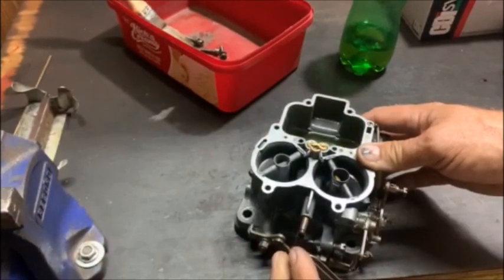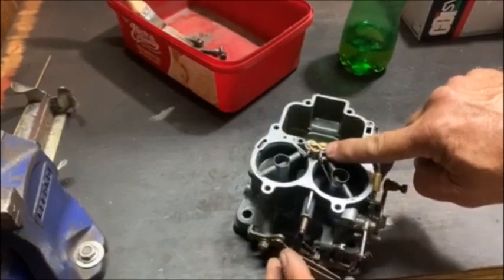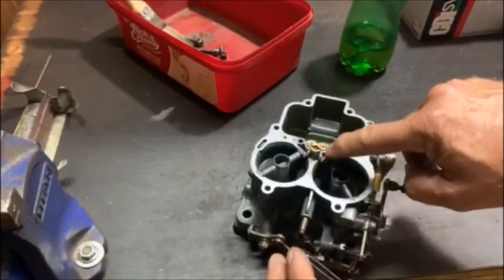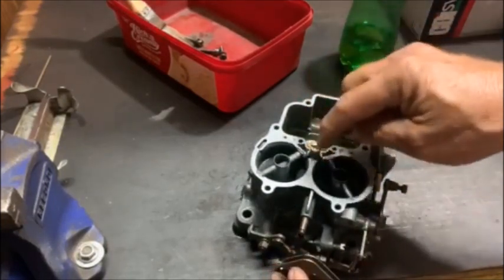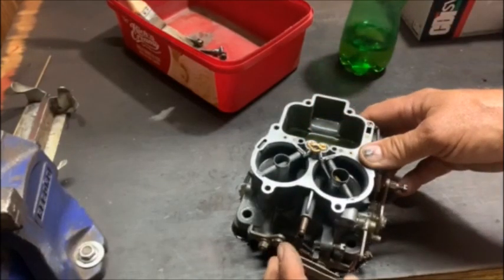And you can see it pumps straight away. I can also see it leaks all over the show. Leaks fuel everywhere. So I'm gonna take that off, put new gaskets on there and put it back and test it again. But it works.